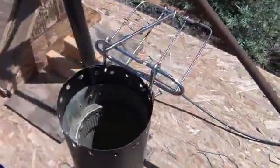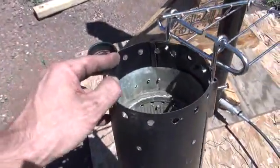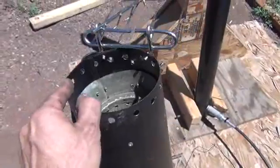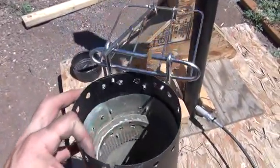You can pull the whole thing open like that. I've got a set of burner holes right here at the tip of my finger — it's going to be very difficult for you to see those in there. Maybe you can see that if I rotate underneath that rim — there's a set of holes right there. So that's our actual first stage of our burn at the top.